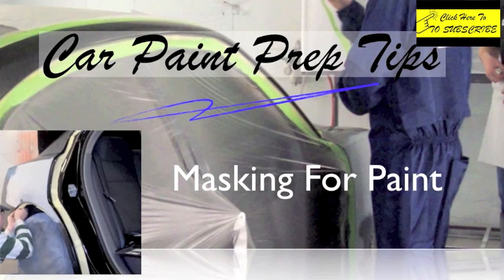We're putting it over there and then we're folding it backwards where it makes a smoother edge. There's not a straight tape line edge there. This is called back masking. That way, whenever the paint folds around the corner, and you do want it to come around the corner just a little bit, or else you're going to see that line. So as the paint sprays around that corner about 1/4 inch, then it's going to hit that tape edge, and it's going to make a smoother edge, a less noticeable edge.